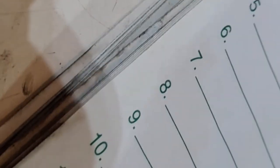Did that. And I'll do a little math here to show you on these rocker arms. Let me find me a piece of paper to figure out how much more lift 1.6 rockers will give you compared to the 1.52s that are on. 1.52 is the rocker arm ratio on the Vortec heads. Everybody says 1.5, which, yeah, but it's actually 1.52. So I think a lot of the cams that come in the Vortec are 0.420 lift. So what you want to do is divide that by the 1.52. Let me get you guys set up here so I can write this down and let you guys see this.